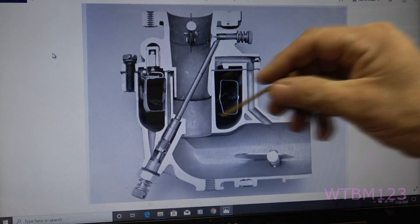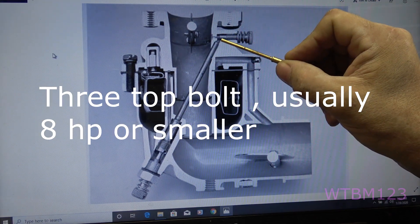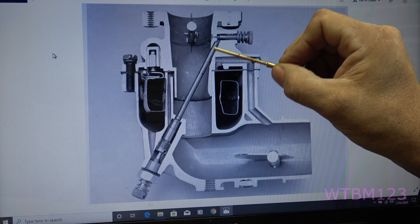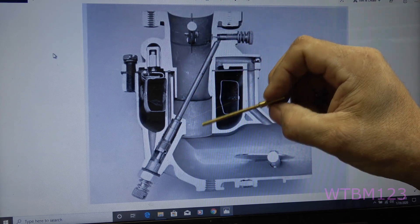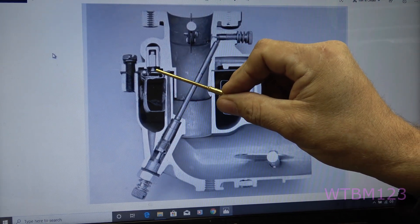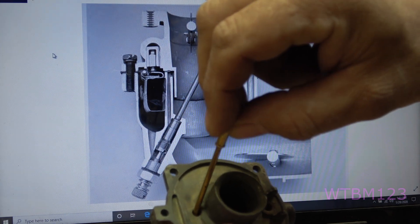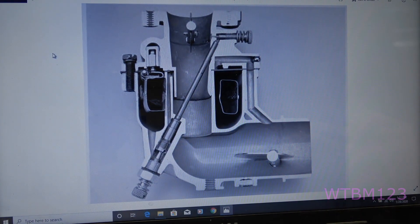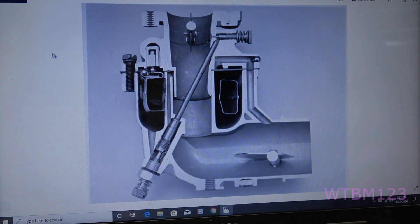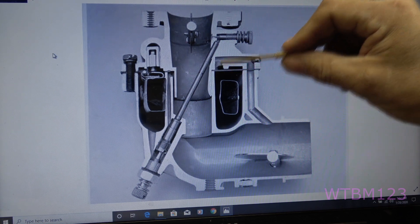Here is a cutaway of a carburetor. The three-bolt and four-bolt top ones are basically the same carburetor. You can see the idle circuit and how the fuel gets sucked up out of there — it comes straight up the tube and into there. That's why this has to be decently fitting right here. When the carburetor is together, if the needle valve leaks it can fill this whole bowl up, and this vent right here comes up, out over here, then down through the carburetor and runs down inside.